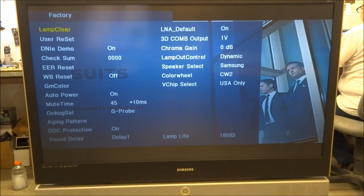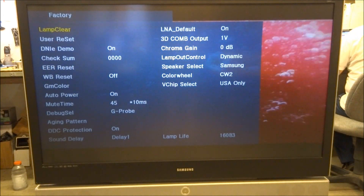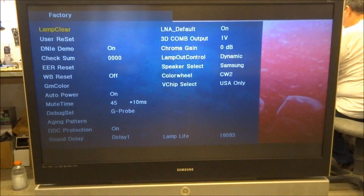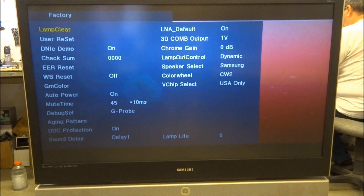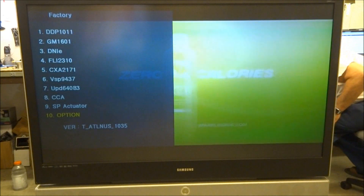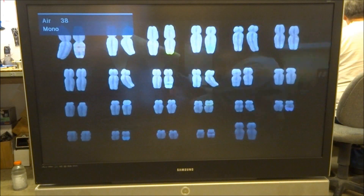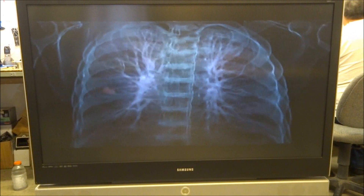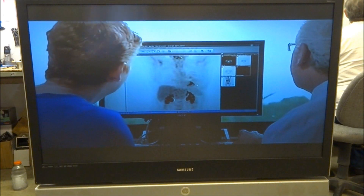Not much more to discuss on this set. The last thing to check is the lamp life — since I used a different digital board, it doesn't know the actual lamp life. I'll select lamp clear in the upper left corner; the lower right shows the lamp life reads 16,083 hours, so I'm clearing that back to zero. Everything else looks absolutely great. You can also check the vertical and horizontal position to make sure the picture is centered, though this model doesn't put up a test pattern for that. To exit the service mode, simply turn the set off, wait for the melody, turn it back on, and you'll be out of service mode and back into regular TV. I hope you enjoyed this video — thanks for watching, everybody have a great day. You can follow me on Twitter at NorCal715. With your help, we can keep a few more of these TVs out of the recycle bin and out of the landfill.